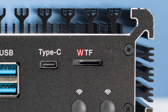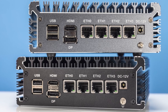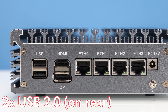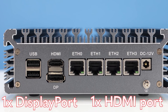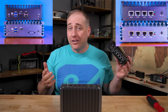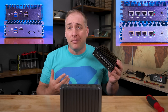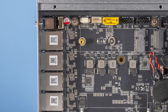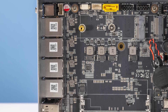If you're wondering what the TF card slot is, it's essentially a micro SD card slot. On the back of the unit we can see definite evolution since we first reviewed these. There are two USB 2 ports, and both a DisplayPort and an HDMI port. In older generations we were lucky to get even one display output, so this is really nice to see. The next feature is the four NIC ports, and when we get inside you'll see the NICs have changed position on the motherboard, which is super interesting.